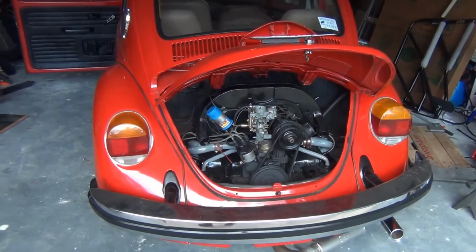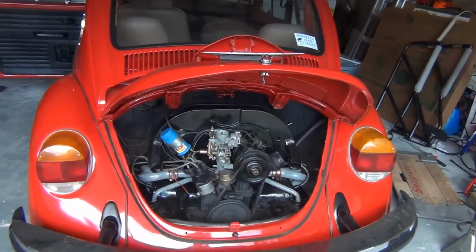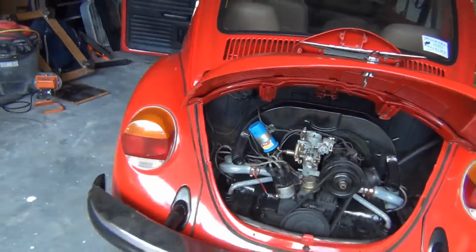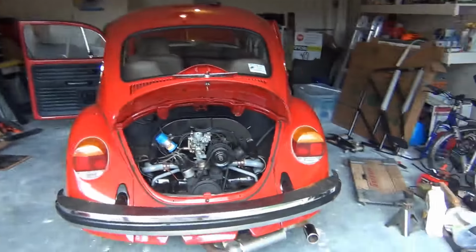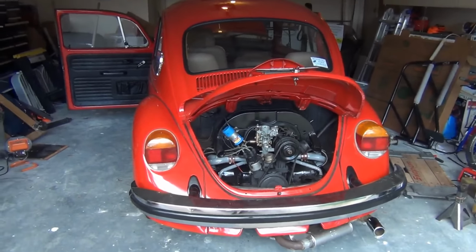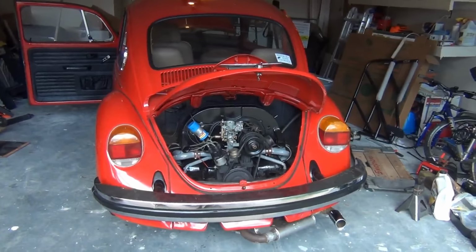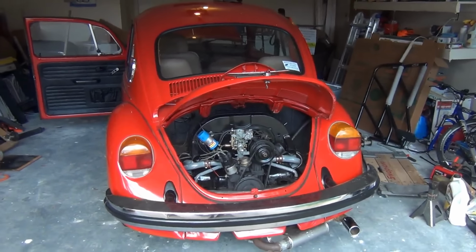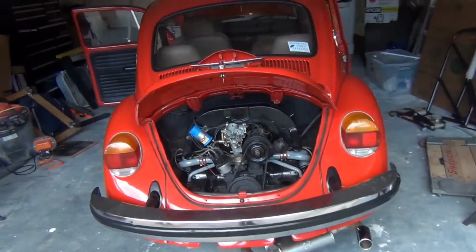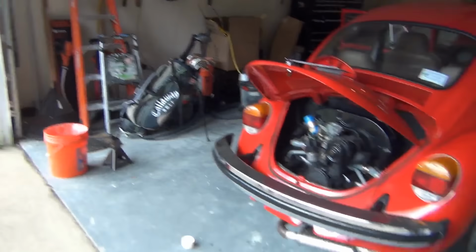That's running with the bad gas in it. Actually, it runs pretty damn good. And when did you ever see it do this before? Yeah, never. Not even when we had it on the stand. So upping that jet size was it. And luckily I had the right size drill to do it. Otherwise it would have been a few more weeks of wait time to get jets for it. And there it is, it runs. Yay!